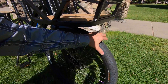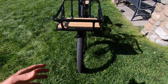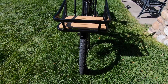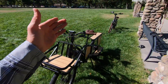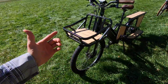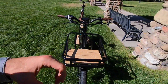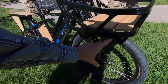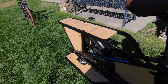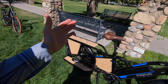Plus-size tires have become popular for mountain bikers because they give you a larger contact patch, a little more comfort and control. So having bigger tires on a cargo bike gives you the same stability benefits. Then having 26-inch wheels versus 27.5 or 28 brings the whole frame a little closer to the ground — it's going to be a little sturdier because the spokes aren't as long. These are thicker 13-gauge spokes. And in the rear, because it has a hub motor, that hub motor is going to have a mechanical advantage.